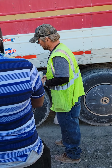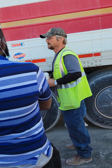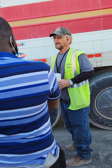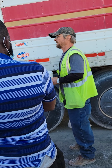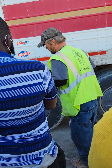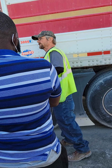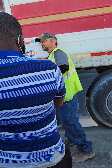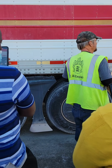Okay? My tires, rims, lug nuts, inner and outer axle seals. Even though these are axle seals and those are hub seals, you still get credit for the same thing. I'm going to spec these like I did on my steers. Not cracked or broken, mounted and secured. Exception: tire depth, no less than 2 to 3 thirty-seconds. In spacing, no debris between the tires. Tires aren't rubbing.